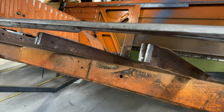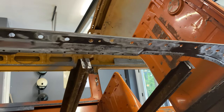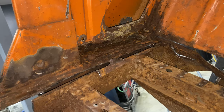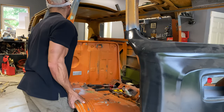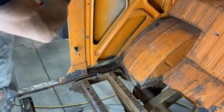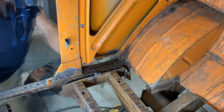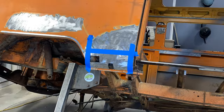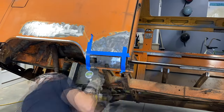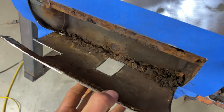One of the first steps I like to take as per usual is to get everything nice and cleaned up, so there's no rust hidden behind my replacement panels. This corner right here proved to be a bit difficult, so I decided I may have to cut out that outer skin — which I didn't want to do. I tried my best to cut things out from the inside to get to the inner rocker and the middle rocker, but it was turning out to be a lot more difficult than I imagined. So I went ahead and ordered the short side rocker from Classic Fab, taped up my cut, and cut out the panel. I'm glad I did because there was a lot of rust in there, and I wouldn't have been able to access the C pillar if I hadn't done this.